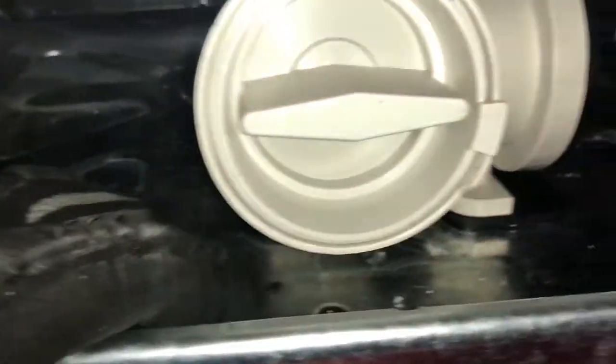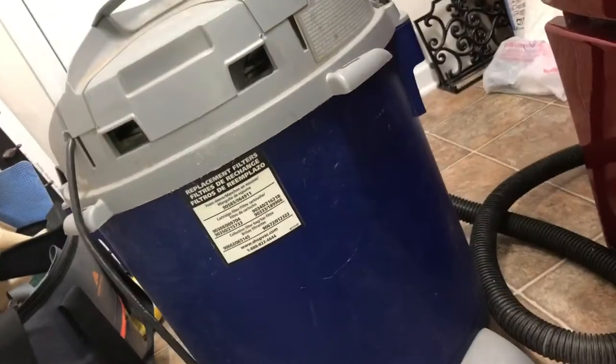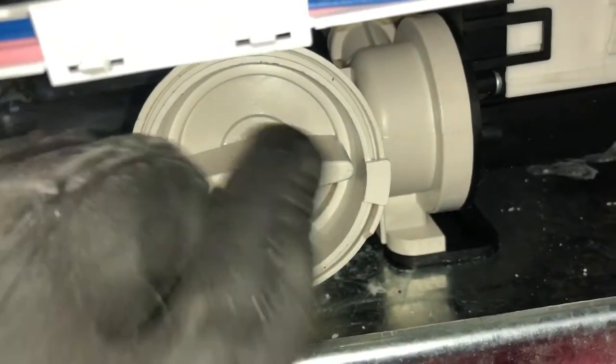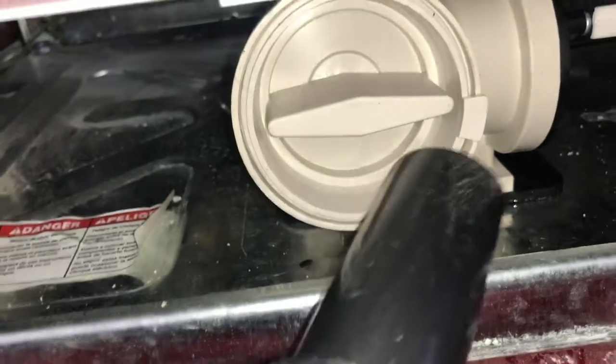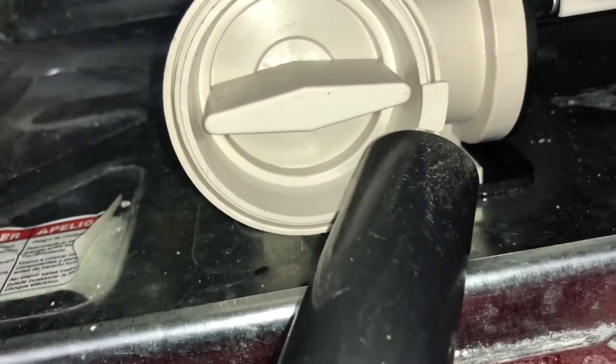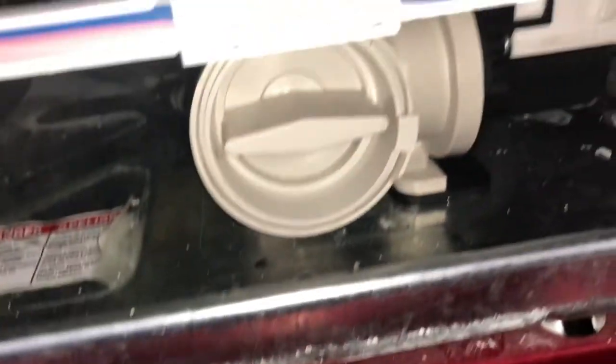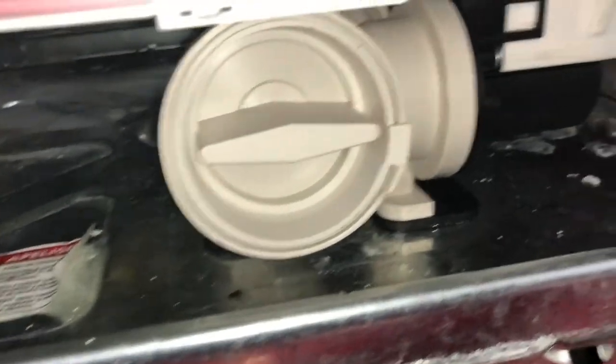Mine has a pinch clamp and an adjustable clamp. The most difficult thing is the black hose because of the clamp. The clamp comes off relatively easy, which I was shocked by, but getting it back on is difficult. We will probably spend the majority of our time messing with the black hose. Other videos show the black hose goes on easily — I'm here to tell you that's your hard part. Have pliers that are worth something to get a wide grip on those adjustable clamps.